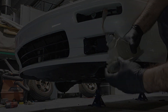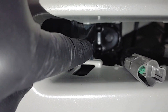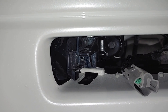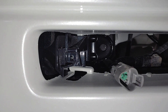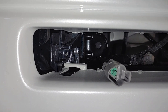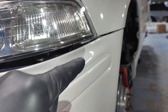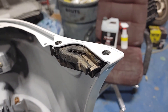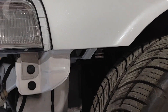The last two bolts to remove the bumper from the car are 12 millimeter bolts located behind the lamps that we took out. These two bolts are the only bolts that securely fasten your bumper assembly and reinforcement bar to the car. If they become stripped out, you're going to be in trouble. I also want to point out that there is nothing that should screw or bolt together between bumper and fender. It is simply a plastic slide assembly on the back of the bumper and a specially shaped bolt that goes into the fender bracket.